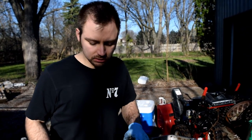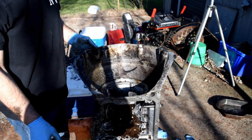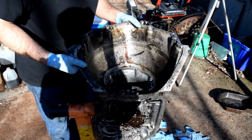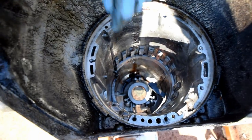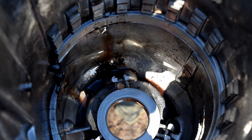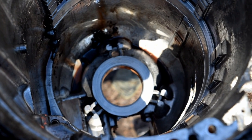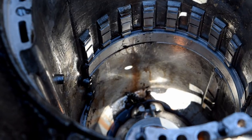We got this piece out — set it aside with the other pieces. There's friction material on that, and if it's done it's done — you can't reuse it or clean it up to reuse; it just doesn't work like that. Now our case on the inside is completely cleaned out. This last piece is our pawl. It's pretty dirty in there, especially the bell housing — you gotta get this thing absolutely perfectly clean. Even a little bit of dirt in there reduces your transmission life by a lot, or it might not work at all.